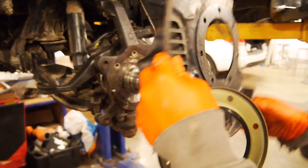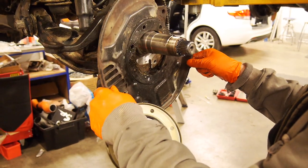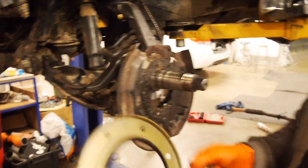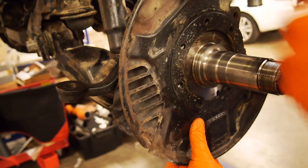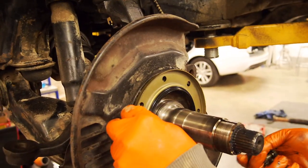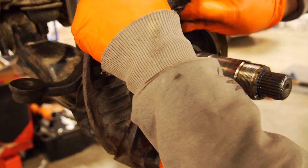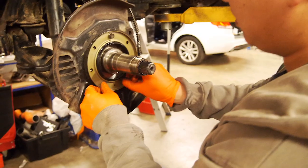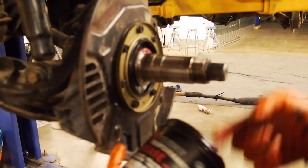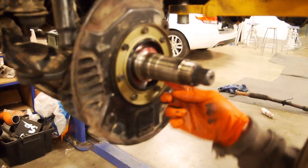If you put the cotter pin in from the inside, it's very hard to flare the two pins out. So what I'm going to do is just rotate that — the easiest way is to put an allen key through the hole, grab the ring spanner and just twist that. It's always stiff to start off. Now the hole is running this way, so when I install the ball joint I can put the cotter pin through the front side and then flare the legs out around the back — much easier to access when installing and removing. So when you line up any of these linkages or tie rod ends, before you shove it in, just check which way the cotter pin hole is facing.